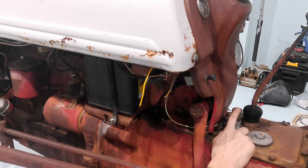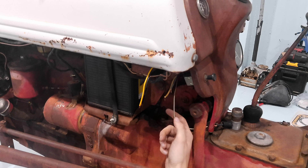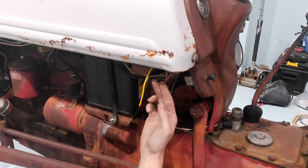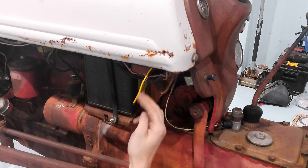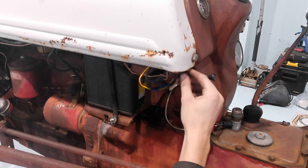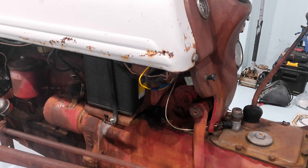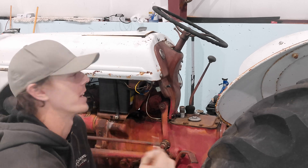Just keep in mind: if you're getting rid of your push button and going to a key switch, you'd have to add one wire onto your start terminal and probably this one onto your coil terminal — this one's your common. Okay, now we've got a key and a dead battery so it doesn't do anything. I don't know about you guys, but I think the key to happiness is right here — as in a key to a tractor.